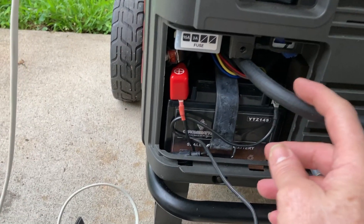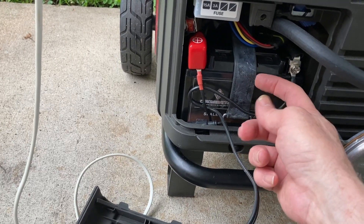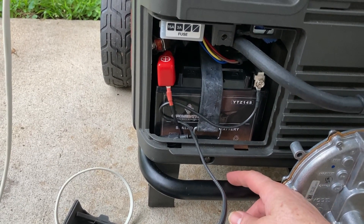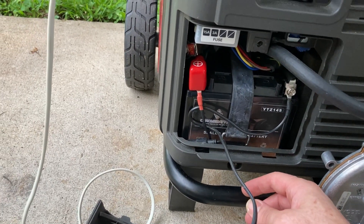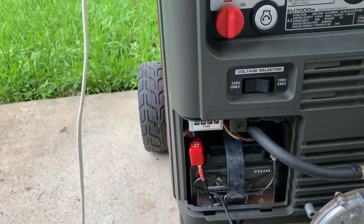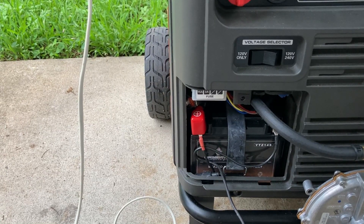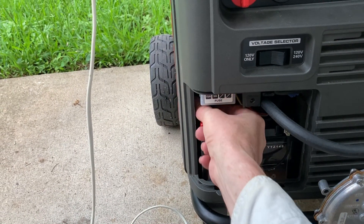It's just like all of US Carburation's kits — it's kind of a bare kit and their instructions are very, very general and not very specific. For example, they had this gas line routed in a way that the battery wouldn't have a hold-down anymore, because they want to run it through the punch-out in the firewall where the back clip is attached — just through a bare, raw-edge metal hole where the clip used to be. They also have a control module — a black box. When my black box arrived, the cover was off, and the box looked kind of beat up. It's all potted in epoxy, so you can't see what's in there. It's a true black box.